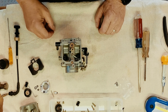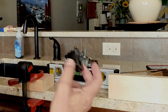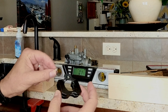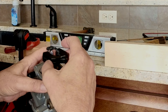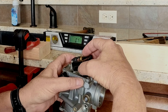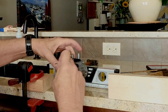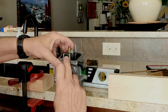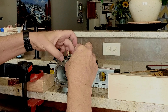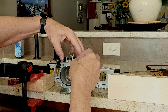Next step is the float. We're going to put the float in with the little valve and its hanger — you can see how we're just dropping that right down in there. Always make sure you put it in from the side opposite the arrow when you're putting the pin back in. We're going to set it far away right now because we need to adjust the float height and check that it's still okay.